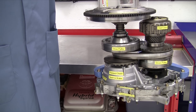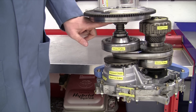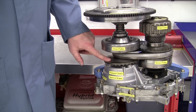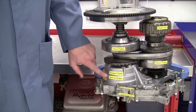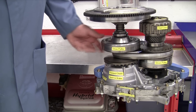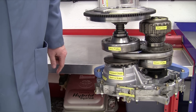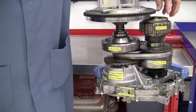This represents our engine — the back of the crankshaft is going to connect right here and turn the input shaft. We've got a forward clutch that provides forward power to the drive pulley, and a reverse brake that reverses the direction. Once this starts to turn, we push the drive belt and turn the driven pulley, which then sends power to the start clutch.